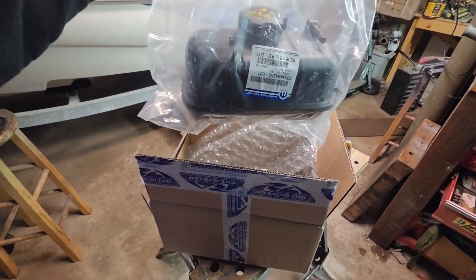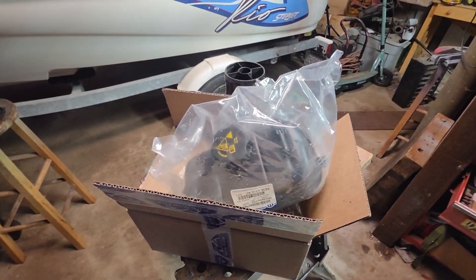Does that mean the new one's going to fail? Probably, but I'm working on a heat shield. If you're going to look for a replacement, I highly recommend you get the Mopar one. The problem with the Chinese ones is that they're cheap and they blow apart catastrophically in like two months. I have about 20 stories from viewers of people that put in a cheap $20 Amazon one and it catastrophically failed. Now you can drive it the way that one is for quite a while — just keep adding coolant — but if it catastrophically fails, you're getting towed home. And just to add insult to injury, the Mopar ones are actually very hard to find — it took about three weeks before this one was in stock at Rock Auto.